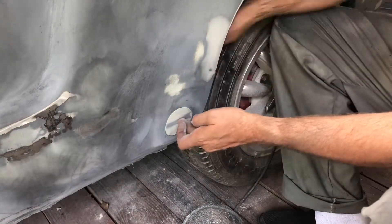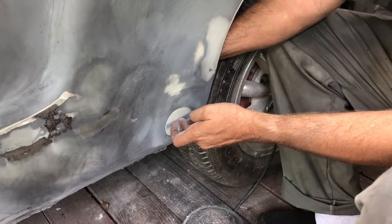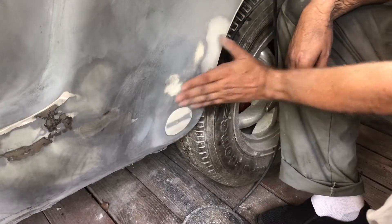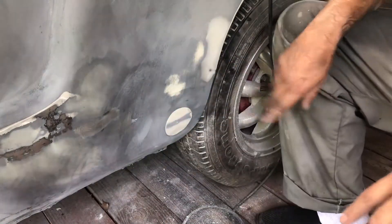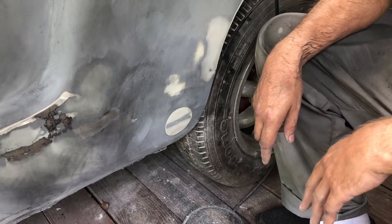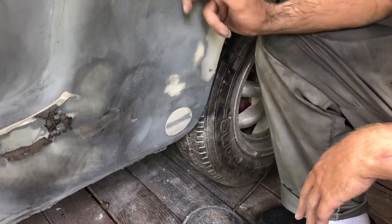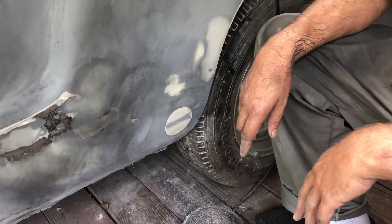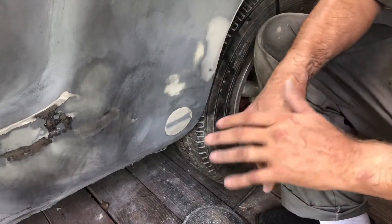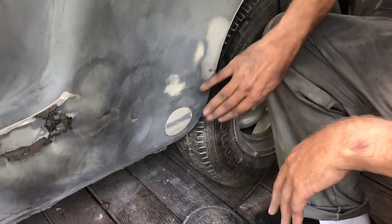Put the nut on the back — fits like a glove. So now while I'm working on this side of the car, filling and sanding, at least I know this part is nice and smooth. Much better. To continue down the driver's side, left hand side of the car, and carry on working underneath the front. Once that's done, it's going to be three to four coats of filler primer, then block sanding with a much finer grit paper to get it nice and smooth everywhere, then two coats of base paint, about three coats of clear, and then start blocking and sanding to get the orange peel out. Anyway, this is where we're at. Thanks.